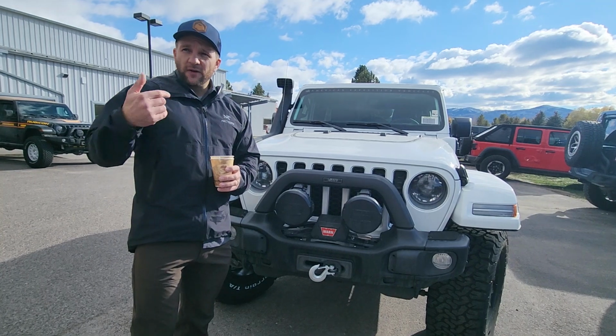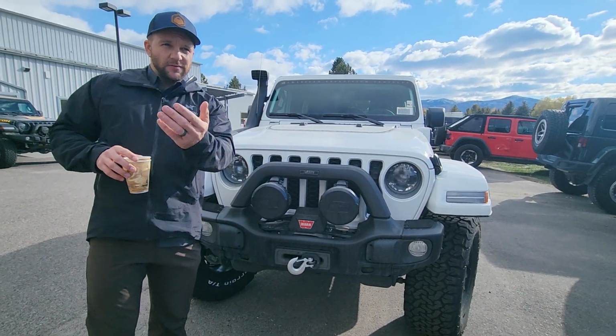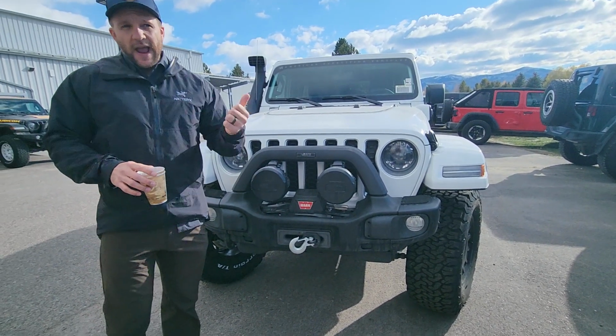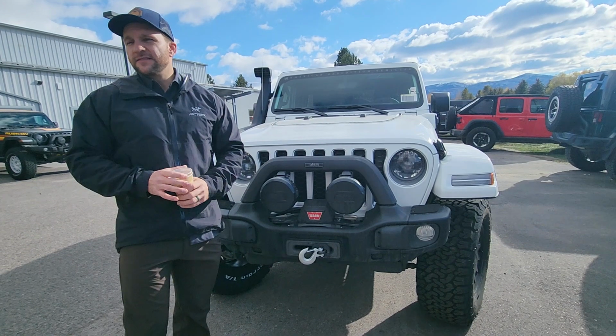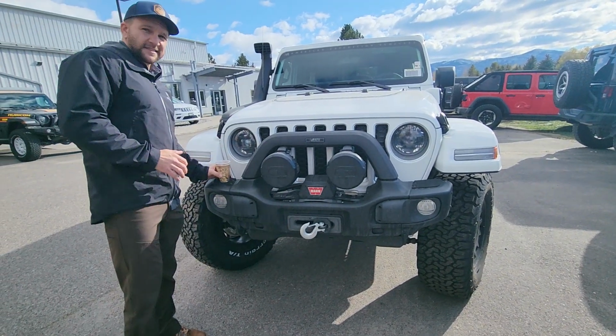So if it's snowing or dusty or dirty or you just got fog in the air, white tends to reflect, where amber can kind of cut through that light and you can see better. So the amber is better for not the greatest of the air conditions, if that makes sense. The white is really nice just for canceling out shadows.